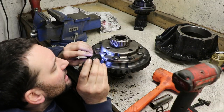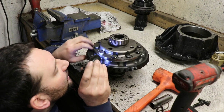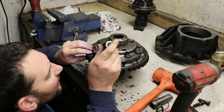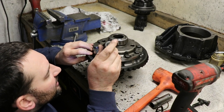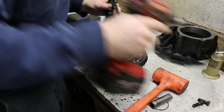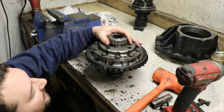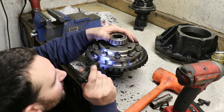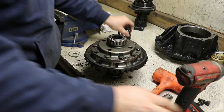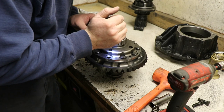What I'm doing here is I'm checking to make sure that the bolt head is making contact with the differential. Because even if there's ever so slightly an air gap, then it means that it's bottoming in the threads and getting tight, in which case putting any torque on it isn't going to do anything worthwhile, which this one is. And it seems to be acting like it's tight. So it's either run out of threads or there's still some junk in the threads, so maybe we'll pull that one back out and chase it again. It looks like maybe it picked up some old Loctite in there.